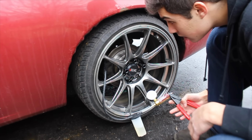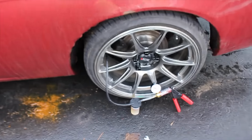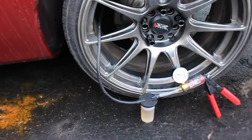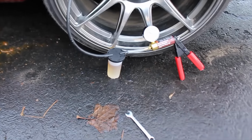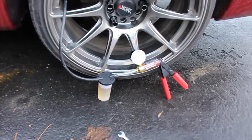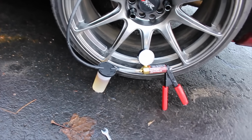So, yeah. Luckily enough, I was able to just pump the brake pedal a few times and actually get all the air out of that line. By doing that, I didn't think I would, but with that little bucket of fluid right there, it doesn't allow you to suck back air into the system. I was watching that little hose in the center there and I saw all of the air come out, and now it's just a steady stream.